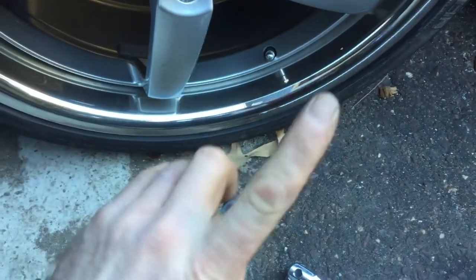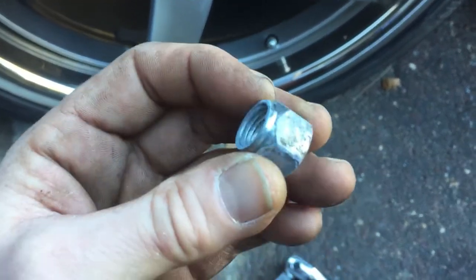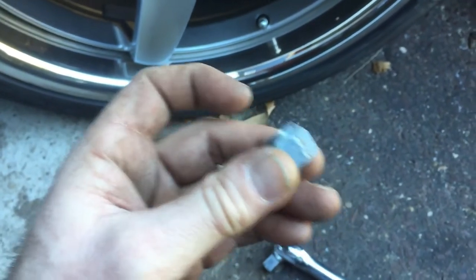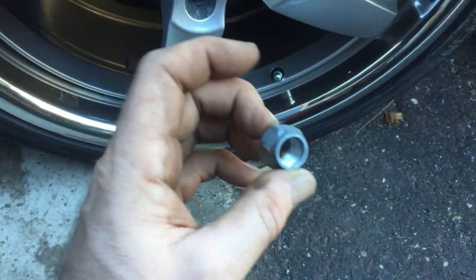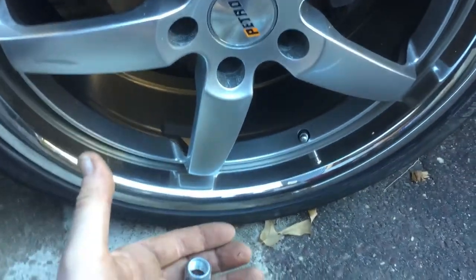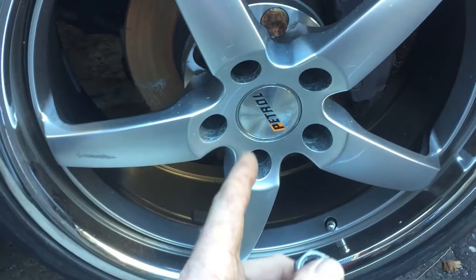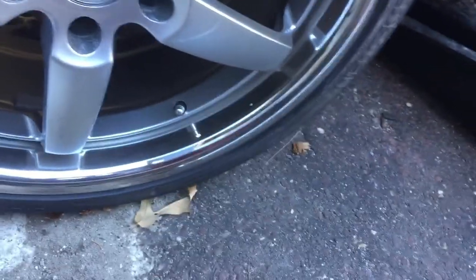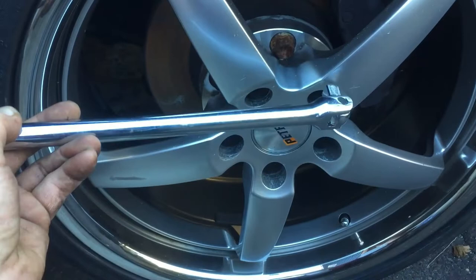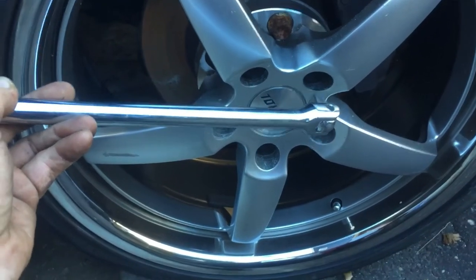Make sure you see that there's a flat end and a tapered end. Some people think the flat end goes against the wheel to lock it on, but that's not true — it's the taper end. You see how it's kind of shiny on the taper? That's because when you lock it in and give it a snug, it squeezes that inside the metal. So make sure you put your lug nuts on correctly. I would never put anti-seize on the threads, because it might cause them to back off and your tire might fall out.